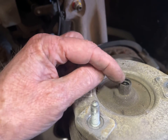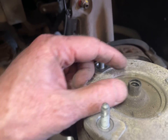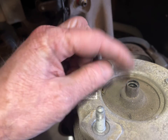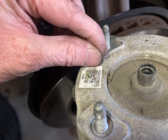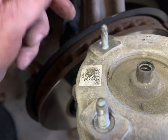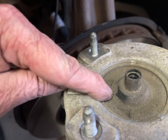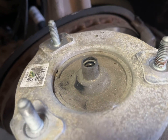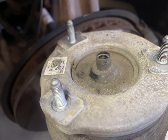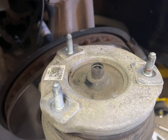I'll get this all put back together, then take the current piece connected to the top of the new strut, install that on the hose, and bring the old one back down here. Then I'll try to remove this cotter pin — you can see there's a little gap right there, so you can put a tool under there and spin it out. I think this is just holding the air in and the air goes around it. Maybe I'll fix it up and have a fixed one if this happens again, because if not it just goes into the landfill — nobody's going to want to buy your janky old air shock.